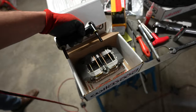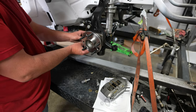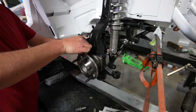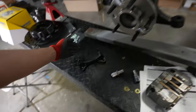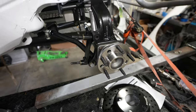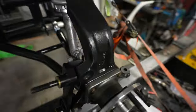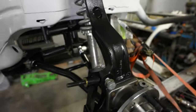You actually put two spacers on these and then they slide up through the holes on the caliper — that's how you attach it. After looking at things, I'm pretty sure this is not supposed to go on first because it'd be super hard to get that bolt on with the rotor in place. So you put all that on, then slide the caliper onto this, then tighten it down. Based on the instructions and the way we're seeing it, that's probably the right way to do it. All right, so we figured it out — we already pulled it back apart, put some red Loctite on this unit, still have the shims in there that they recommend, everything's lining up just like they said.